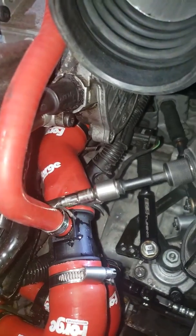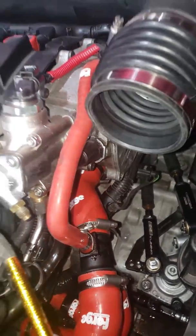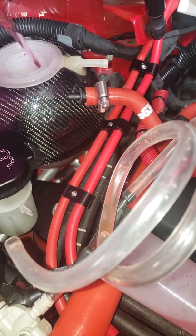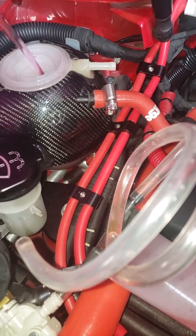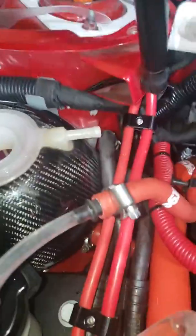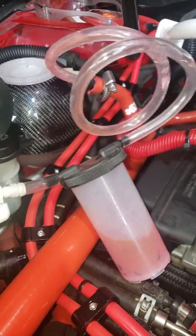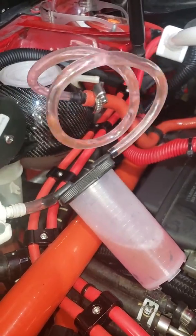I don't want to go too tight and break it again. Now that we're at that point, we're going to use the Mighty Vac. You're going to want to keep your coolant reservoir full or else you will start sucking in air, so add a little bit extra. All it has to do is fill up that line, so it won't take too much. Then connect your vacuum pump to the end of the return line and start pumping.